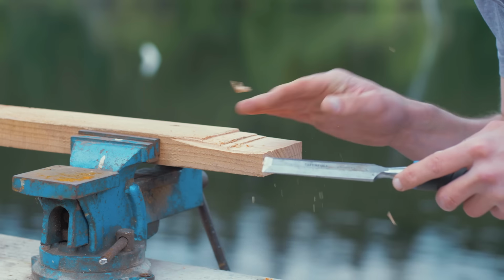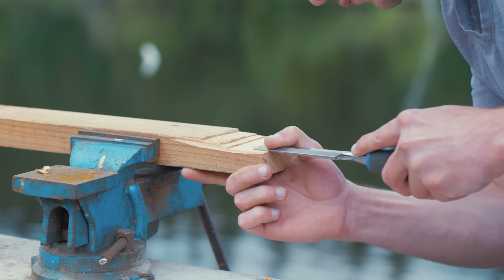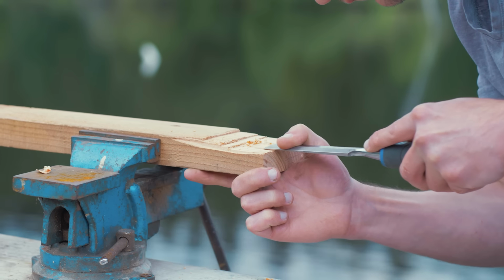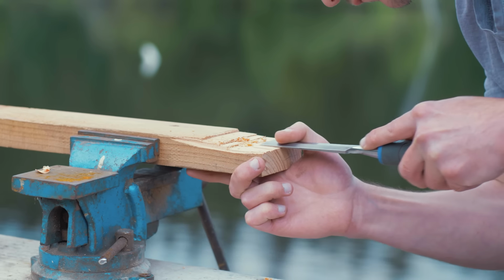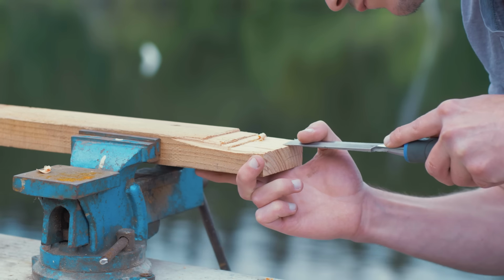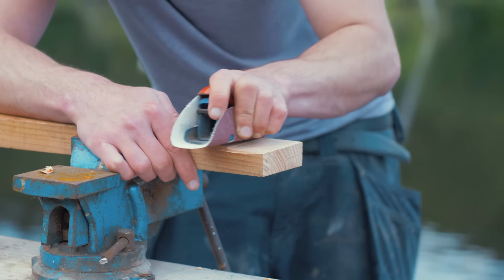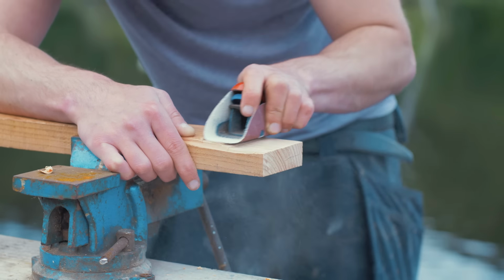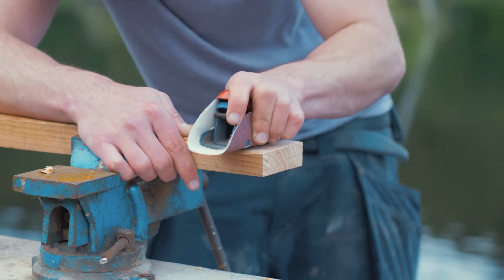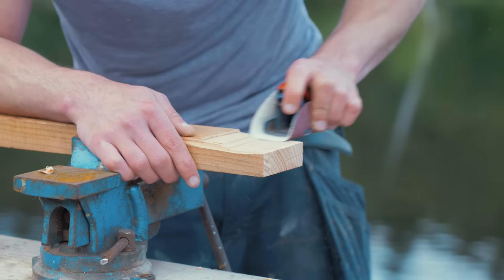So I just used some Douglas fir here to basically replicate the other plank that was in it, to replace the plank that was here in front that was also securing the lifting eye. Underneath this are a few slabs of pure mahogany, the real deal before it was any of this Sapele, the real mahogany that was being harvested in the 40s. It's nice to just put that back in place, even if it's not structural or integral. But just to get it back in place, so the deck planks or the deck plywood will then sit on that evenly as well.